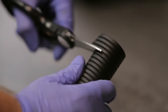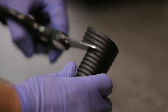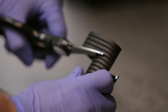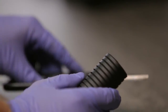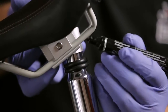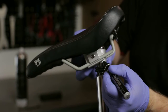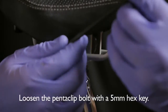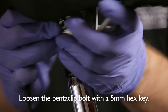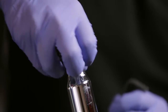Cut the sleeve at the appropriate groove with a pair of scissors, taking care as you do so. Before removing the saddle from the post, mark the position of the pentaclip to ensure that you can refit it correctly. Remove the saddle and pentaclip from the post using a 5mm hex key. If there are any o-rings fitted to the post, these will also need removing.